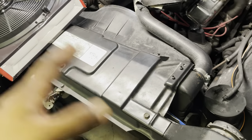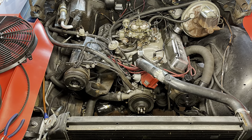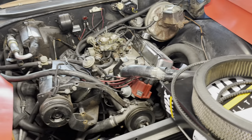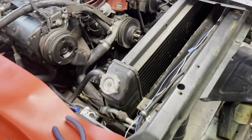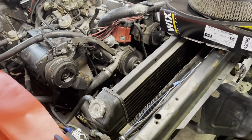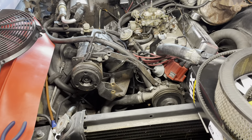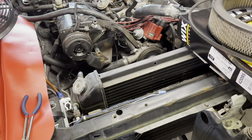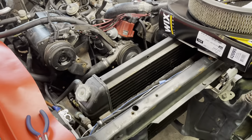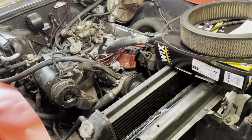I think the next steps are just to take all this off, move that shroud, and try to start placing the fan in there. I have already been kind of hard at it. Since it doesn't have a cooling issue — look at this radiator, it's super thick — that shroud is awesome and that fan works perfect. I never had any cooling issues, but when I went on my last car cruise, we were stuck in traffic for quite some time and you could see the temps rise a little bit. I would have to put it in neutral and bump the RPMs up to cool it. So I thought if I could get a slim fan hooked up to a switch so I can turn it on and off as needed, that would be great.